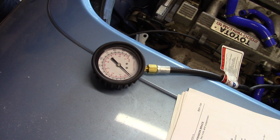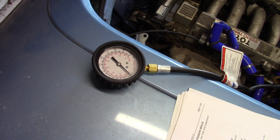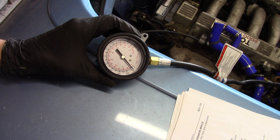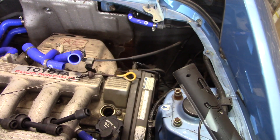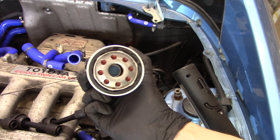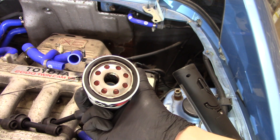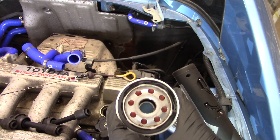Let's see what happens. That's a new noise — idiot, I left the spark plug things in. Let's try again. Well, that is bad news. I didn't see any movement at all. At this point there are two possibilities: first, the oil pump doesn't work — hopefully not that; secondly, it's just not primed and not moving any oil. I've taken out the oil filter and, much to my surprise, it looks like I didn't prime it when I put it in. Normally I would. So I'm hoping if I fill it with oil and reattach it, some of that oil will end up back in the filter and help it prime.